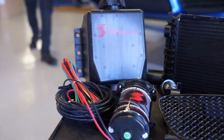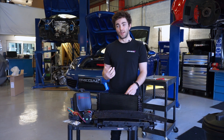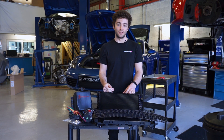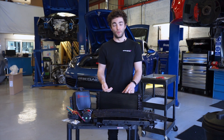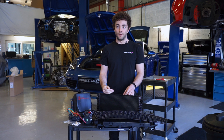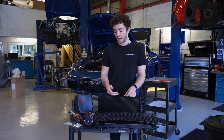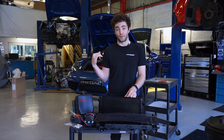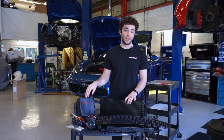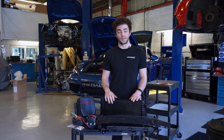We've also got a water meth kit here. If you're not familiar with water meth, basically the water cools down the charge temps — just like an intercooler, whose purpose is to cool the charge temps. The methanol's purpose is then to increase the octane levels, so it has the effect of using a high-octane fuel. On these cars where no charge cooler upgrades are currently available, once charge temperatures start to increase the ECU automatically reduces power output through various ways. A water meth kit is a good way to overcome that problem and allow you to enjoy maximum power for more of the time.